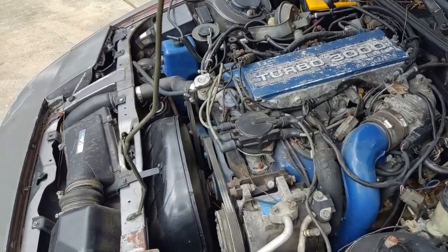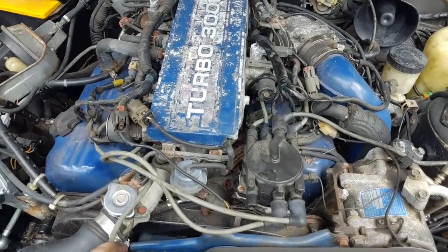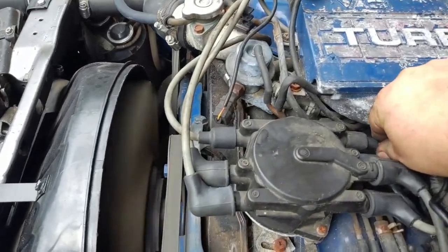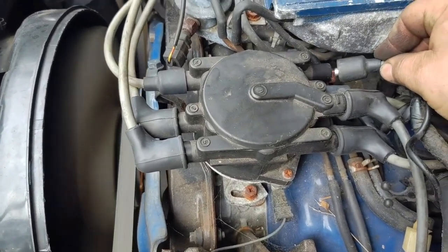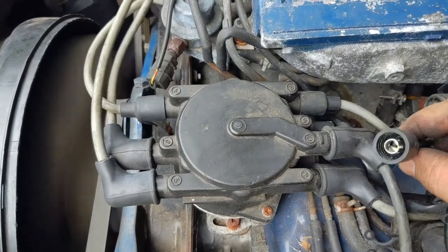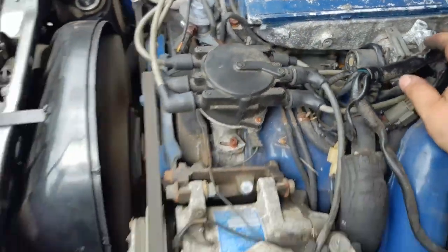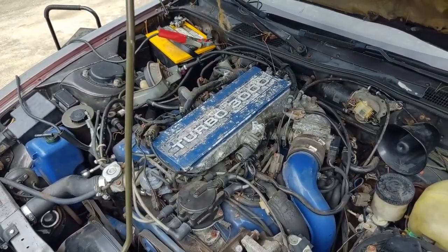Guess I will go back through and at least check those same cylinders again. Make sure that they're not causing a problem. So, number one, whole lot of nothing. Number two, whole lot of nothing. Lot of nothing. So it's either they got a problem with the injector, it's a bad connection on them, but I'm guessing my next thing I'll be doing is pulling the intake manifold off and getting the injectors pulled out.